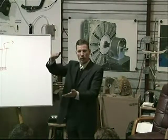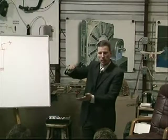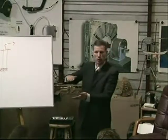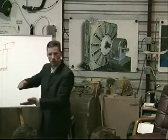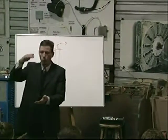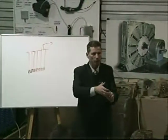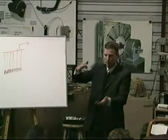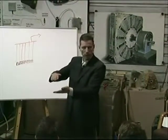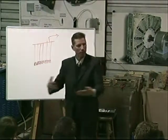So as the water level goes down, because we're converting it into water gas, the concentration of the electrolyte goes up. So whether you've got this much water in there or this much water in there, chances are your amperage draw won't be that much different, because you still have the same concentration. With a weak concentration up here, you've got a lot of surface area on the plates exposed to the water, so you draw 15 amps. But as the water's consumed, you have less and less surface area exposed to the plates, but your concentration of electrolyte makes it easier to pass voltage through.